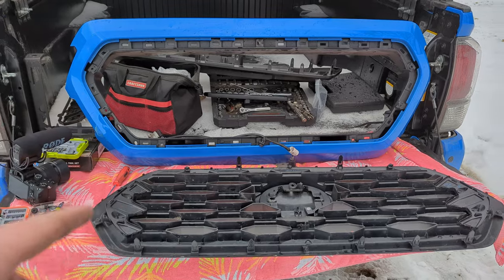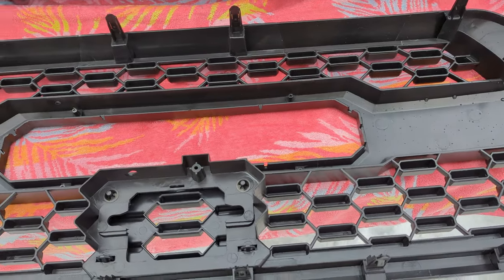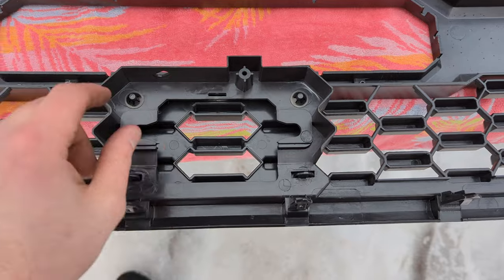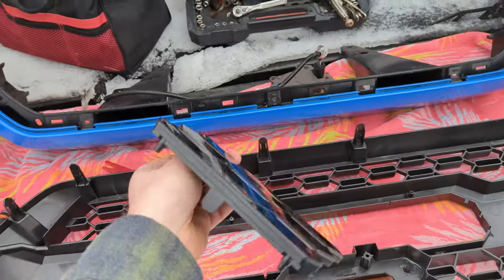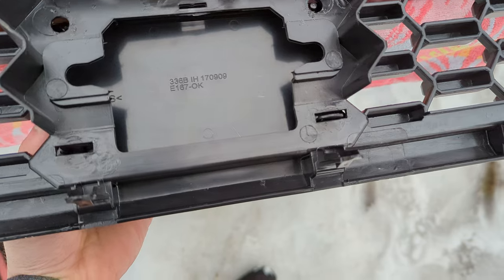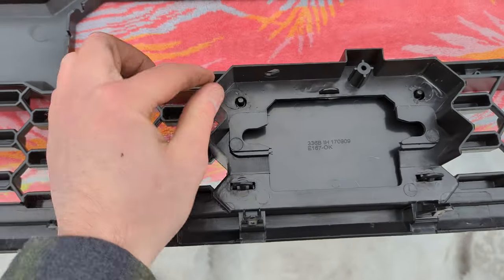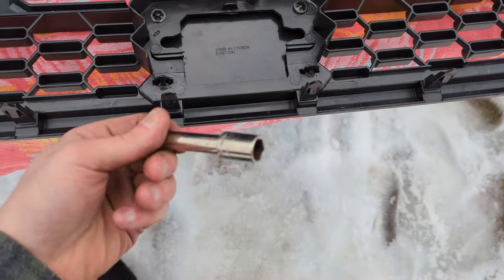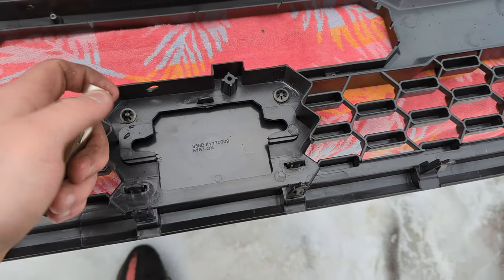We just got the old grille out pretty easy once you got those push tabs in, went around the whole grille clockwise. Not a big deal getting that out. I'm going to get the other grille prepped and get some working space on the bed here. Now if you look, this is where the new sensors are going to go, but there's this insert here so I'm going to go ahead and remove that — looks like I just got to push these tabs in and pull that off. I have the garnish now for that sensor. I'm going to push it through just like this and get it all clipped up there. They did include extra little clip things to keep that top part sealed in. I grab a socket, put it on there and push — that'll get that to push on and stay so it doesn't push out.